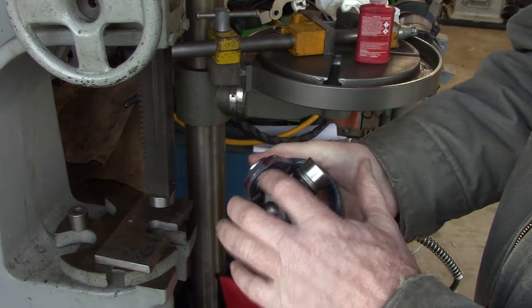Common sense stuff when going back together: make sure your gears are meshing — you've got forward and reverse, upper and lower — make sure both are engaged. Wiggle everything around as you go back together. If something binds up, don't force it — step back and see what's going on. There is quite a bit of tension on this o-ring when you get to that point; it usually takes a little force, but you should be able to push it all the way in by hand. The fit around the machined surface is very tight, so it can bind — just finesse it, don't force it. That's pretty much all there is to doing the u-joints.